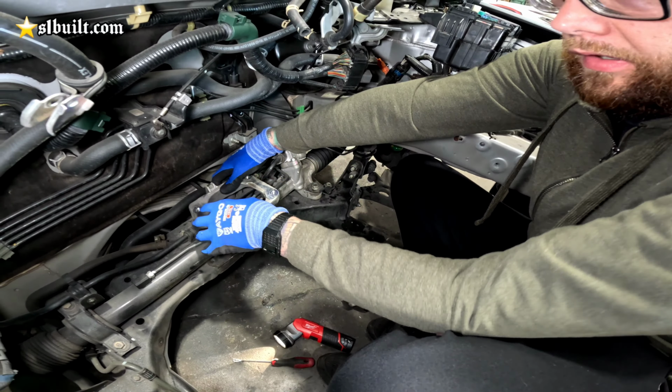Oh! The motor is held in by its own mounting for now. Thank you to Hasport. But we have to do some modifications. First off, you can see there's no such thing as an all-wheel drive trans mount over here. So that's floating, and what's holding it right now is this front mount from Hasport and this rear mount. But there's a factory mount, which is not going to be modified. But there is a but.